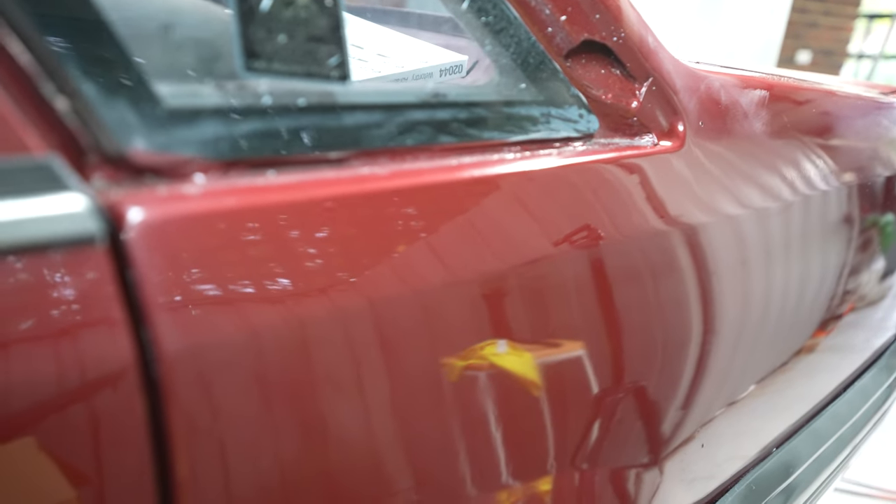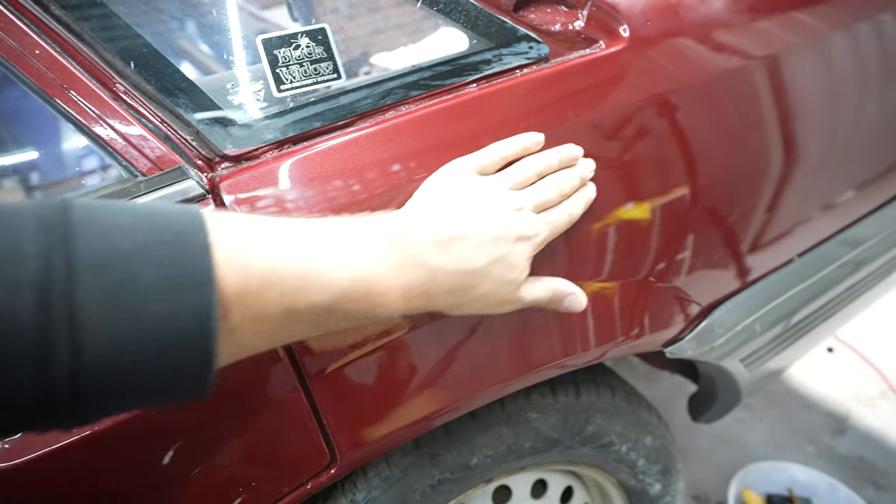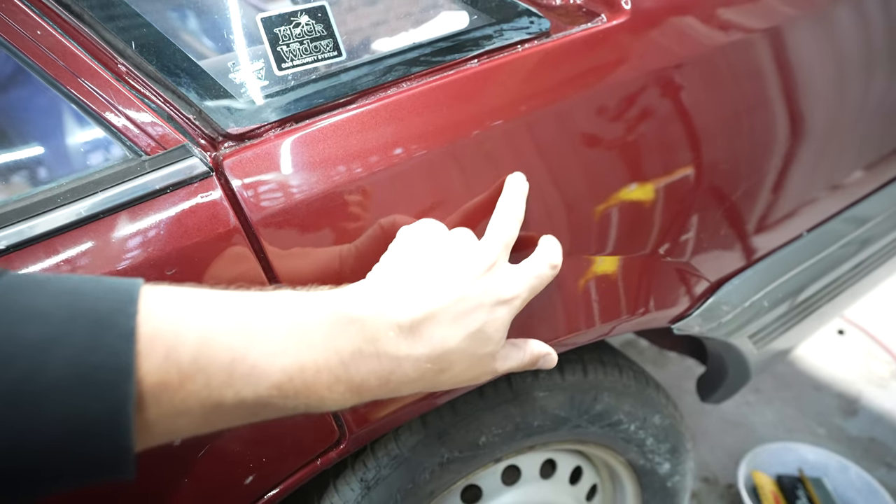You can see the reflection. A good way to know if it's good is that you can read something reflected from back there. You can see in the paint there's all that peel — then up at the treated section it's smooth. Show the before there and the after. The next step after this is to use a machine polish, and then you want to seal it with some kind of ceramic coating, wax, or protectant. You just have to keep continuing that process for the rest of the whole car. That looks a lot smoother than it was before — you can feel it; this part feels so smooth and then along here is rough.